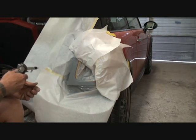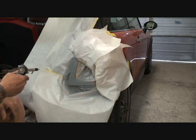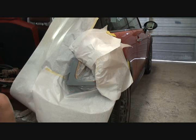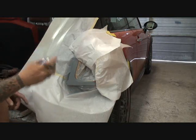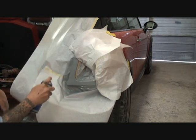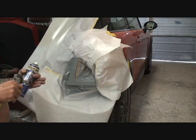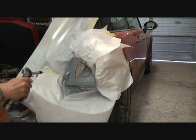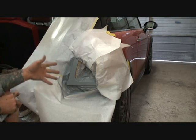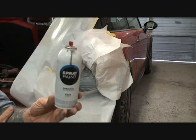I'm going to speed up the drying process — just barely blow air on it to make it tack-free. I'll go ahead and put one more coat on there; shake it up before you use it. Take my air hose, dry it to a tack feeling. Once the primer has come to a nice tack-free dryness, before you pull all your paper off, you want to go ahead and put a nice good guide coat on it.